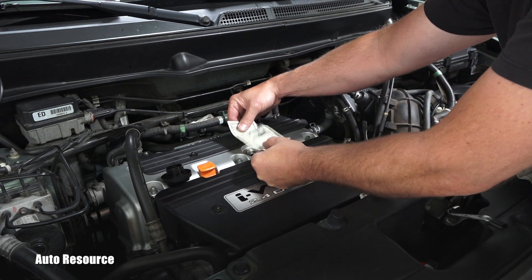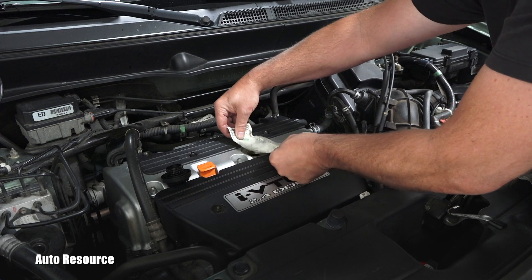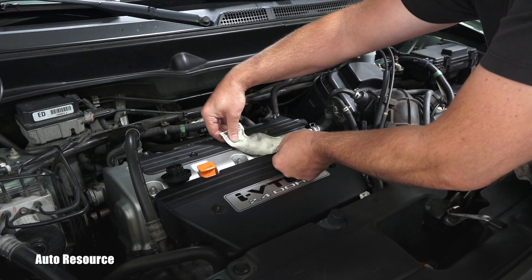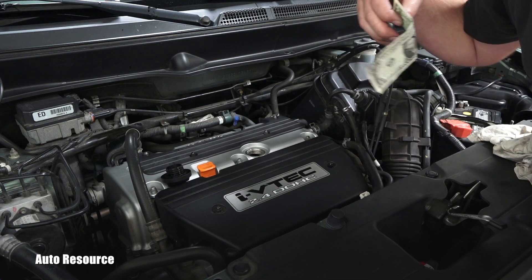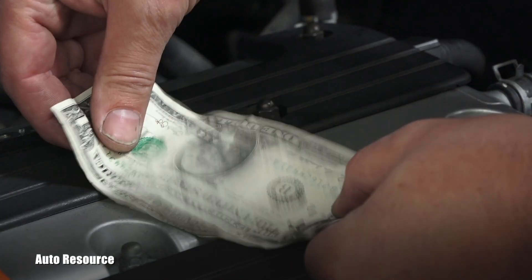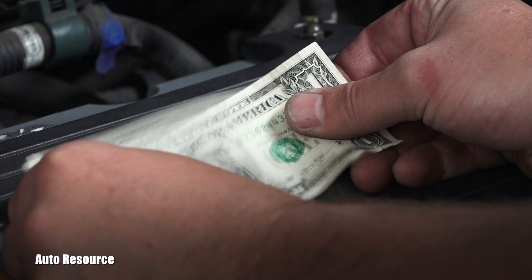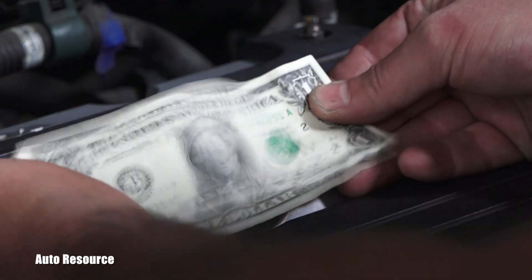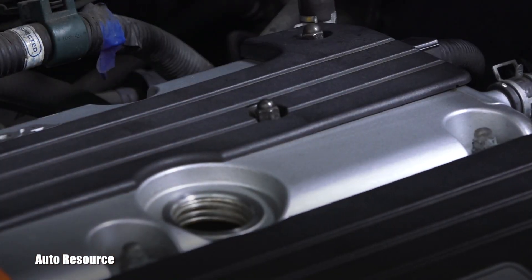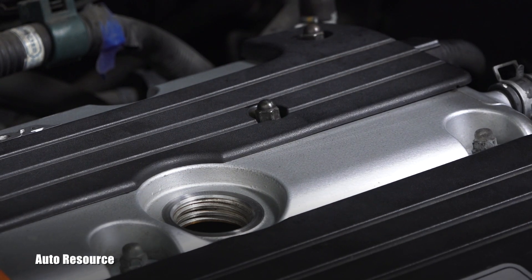Hold that paper bill with both hands — you don't want to suck it in. Look at it. Do you see that vibration? That cannot be there ever. Let me zoom in on it. Look at this. Isn't this amazing? And once again, this is a burned exhaust valve on cylinder number two on this four-cylinder Honda engine.